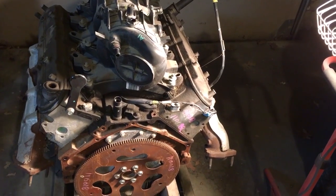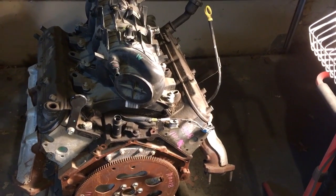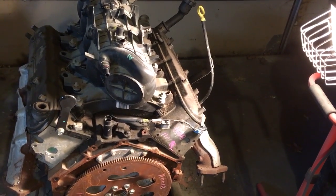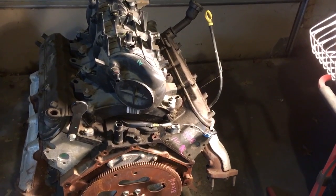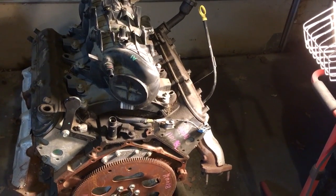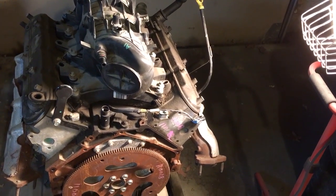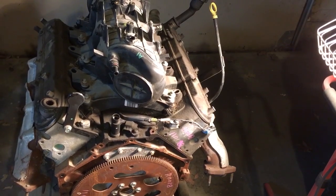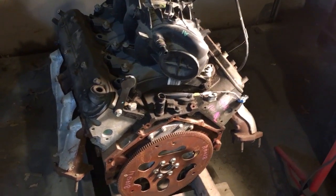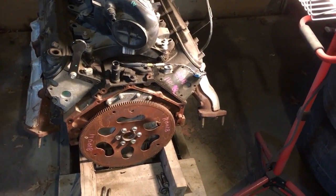This relates to people who put horsepower limits on these engines. Some say they had a gen 3 and around 600 to the wheels the rods bent and they had to rebuild. But then someone else says they put 750 to the wheel with no problem out of a gen 3 — maybe they got lucky and bought a crossover year with the rear cam sensor but better pistons and rods. We need to do more investigating to verify exactly what engine was used and how much power they got away with.